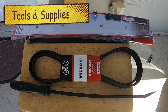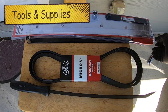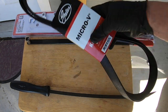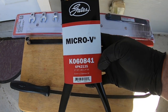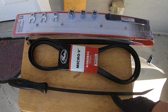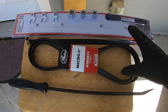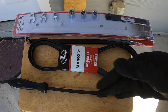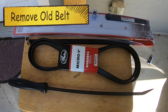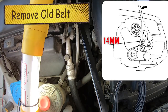Here are the tools and the supplies for this vehicle. One of those serpentine belt kits works really well and it uses a 14 millimeter on it. This is one option for the belt — I'll put some others down in the description below. We also use this long pry bar to hold the belt up against the crankshaft, to give it some pressure because it's so far down in the engine bay. Go ahead and get a 14 millimeter with the extension for the serpentine belt.